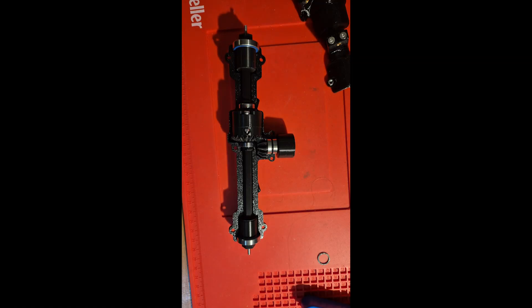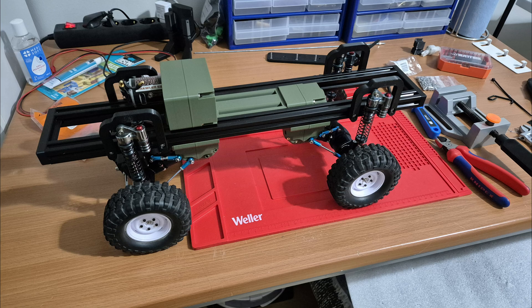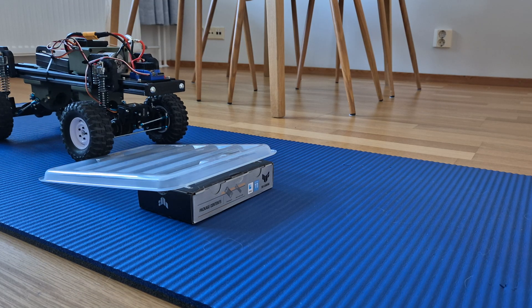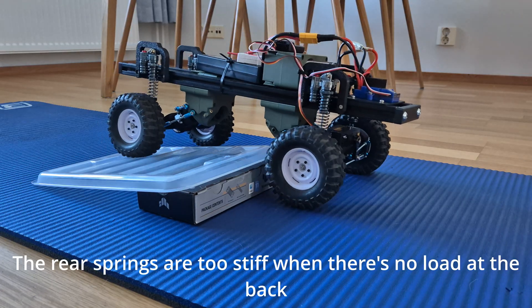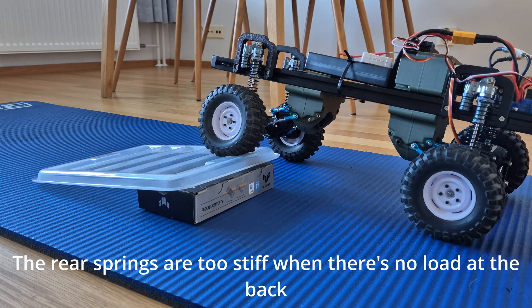To save time, the third axle with no steering uses mostly the same parts as the steering axles — not the most elegant solution, but it seems to work okay. The linkage is the same on all axles. I used a calculator I found online to aim for 100% anti-squat. No idea how well this will work in practice, but we will see. Other dimensions are either defined by the geometry of the vehicle or good practices mentioned in some sources online. I had never designed a linkage like this before, so it will be interesting to see if this works.